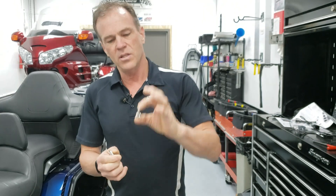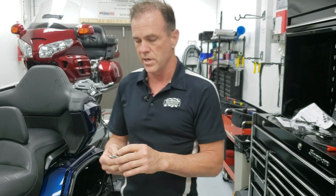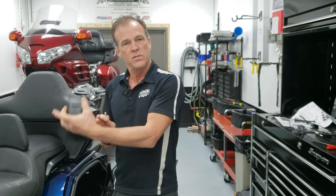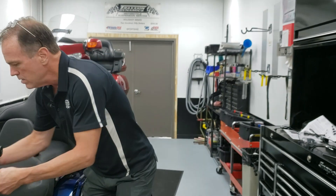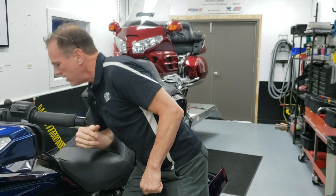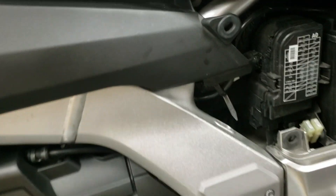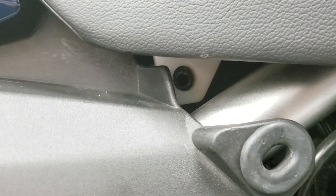The bolts wobble in the seat pan. There's a little taper on the end of this bolt — we actually looked at putting this on our bolt as a feature but decided it just wasn't necessary. The older bike had a long handle with a long bore, spacers, and went through the seat and then into the frame, so a taper was actually beneficial lining up three inches of stuff. But on this bike it's not necessary. If you do my trick of just elbow into the saddle twice on either side, when you come look you'll see the holes line right up, and you can just put the bolt in.